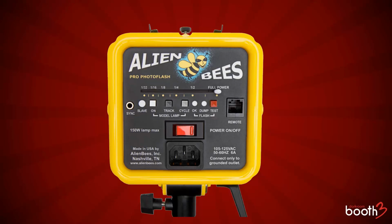The best way to test that is to unplug the camera from the computer, the USB cable, and press the shutter release on the camera so the camera takes a picture, and see if the flash goes off then. So that's the best way to test that.